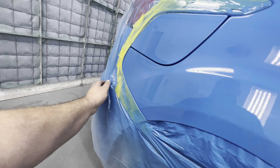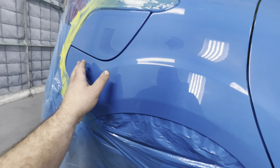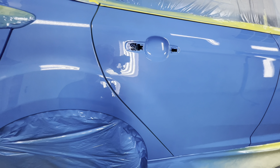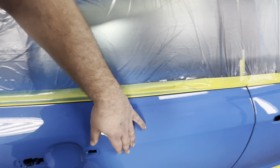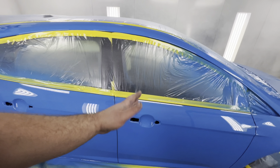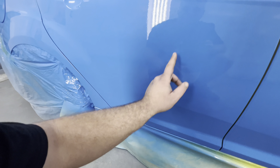We did the best we could coming into this corner to stay away from our bumper cover. You can see just a little bit of overspray on the tape, but we really needed to stay away from that bumper cover so we don't have a butt match there. This is a very small short quarter panel — actually shorter than the door — so there wasn't a lot of room. But I think we did just great. We kept the color below this body line, with maybe a little bit coming up over for a nice gradual transition, creating an illusion to the eye of one color. I could have potentially stayed in that rear door but our repair area only left me a couple inches for sealer, base, and pearl.